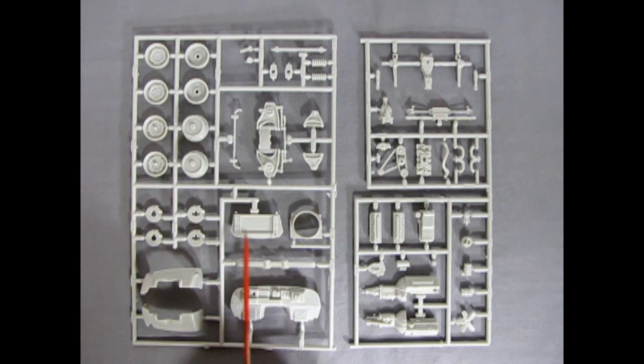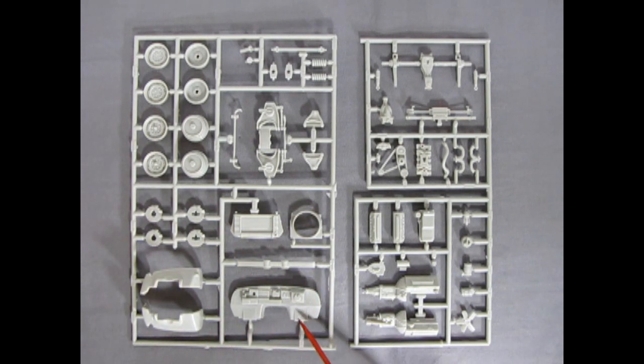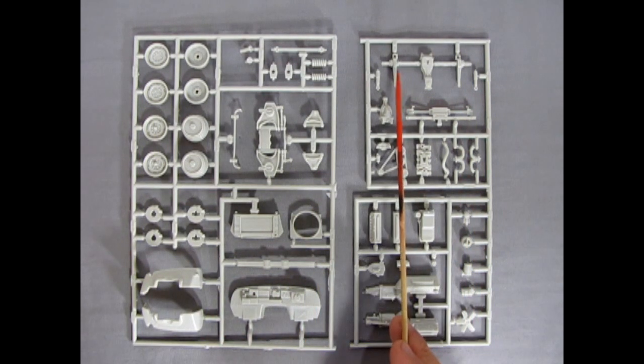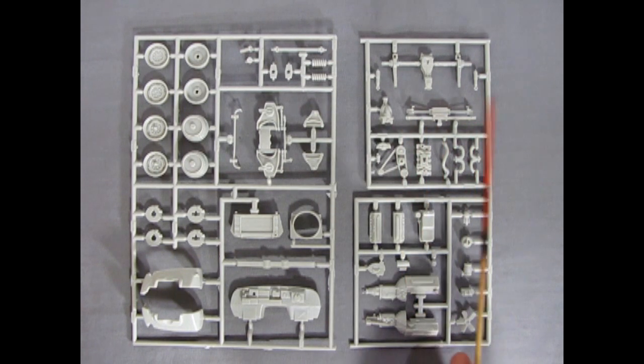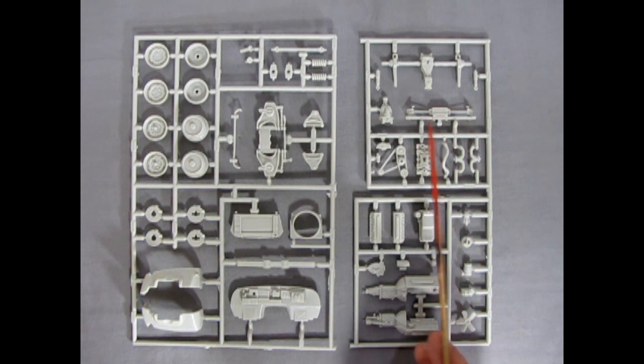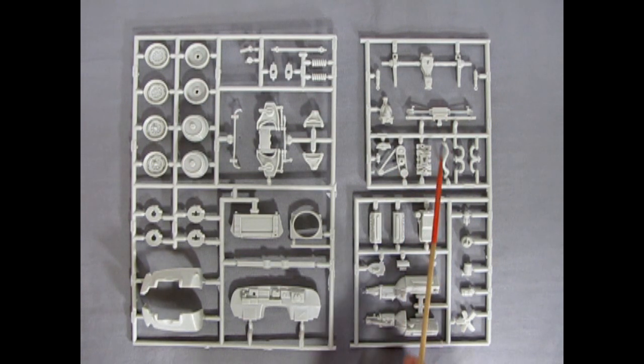And there's our radiator, our fan shroud, our inner fender aprons, our firewall, the, I guess, upper differential. And there's the bottom part. Oh, that's the bottom, because we're upside down. There's our shock absorbers, the rear spring going across there. One mono spring, like a Model T, except this is independent style, Jaguar-type rear suspension.